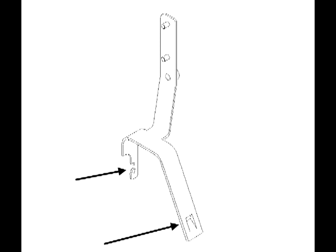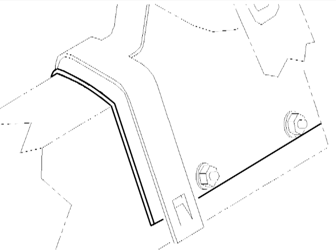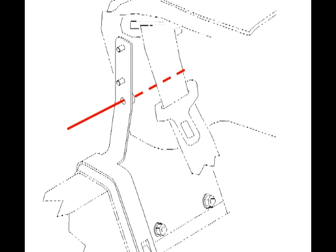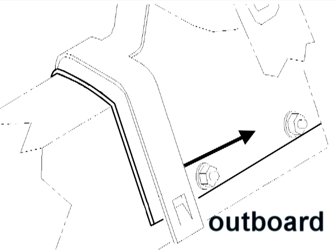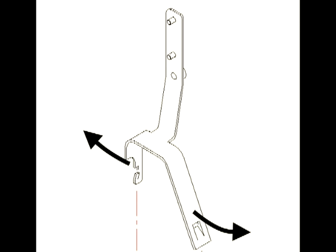The two tabs are what allow these metal brackets to snap down onto the frame securely — the back and front tab should clamp down onto the frame. To make sure we're snapping the bracket into its proper position, the side of the bracket should be approximately three-fourths of an inch away from the side of the frame before snapping it down. Make sure the bushing lines up with the hole in the cover panel. If needed, tap the feet of the bracket in an outward motion until the bushing perfectly lines up. Be careful not to bend out the feet — if you do, the tabs won't snap in under the frame tightly. If you bend it accidentally, just bend it back.